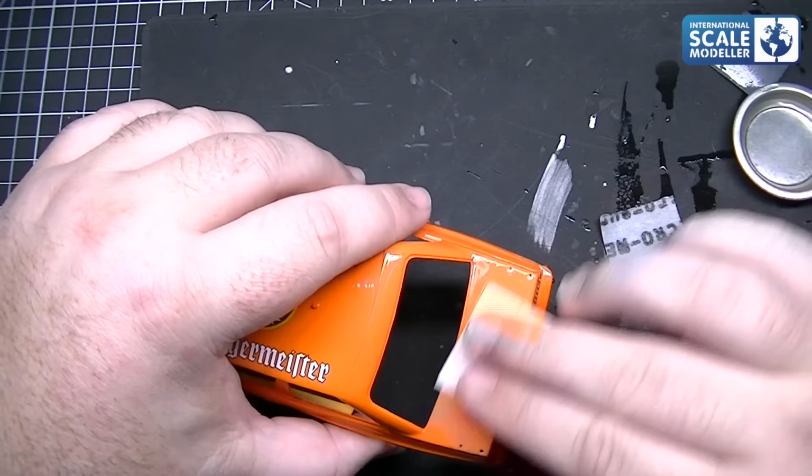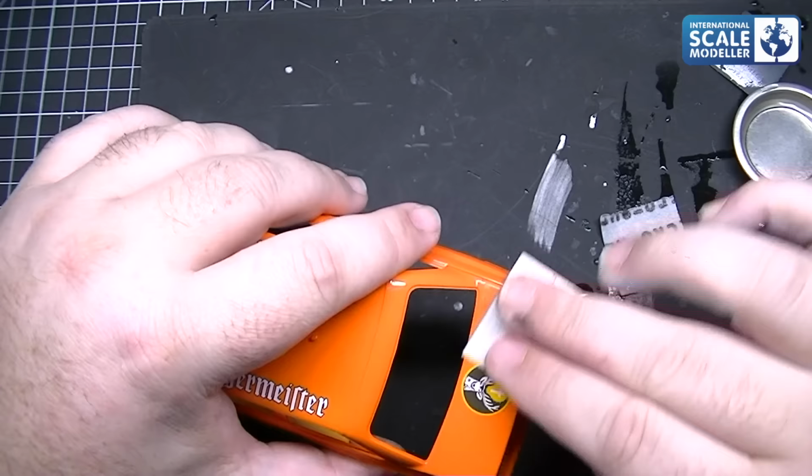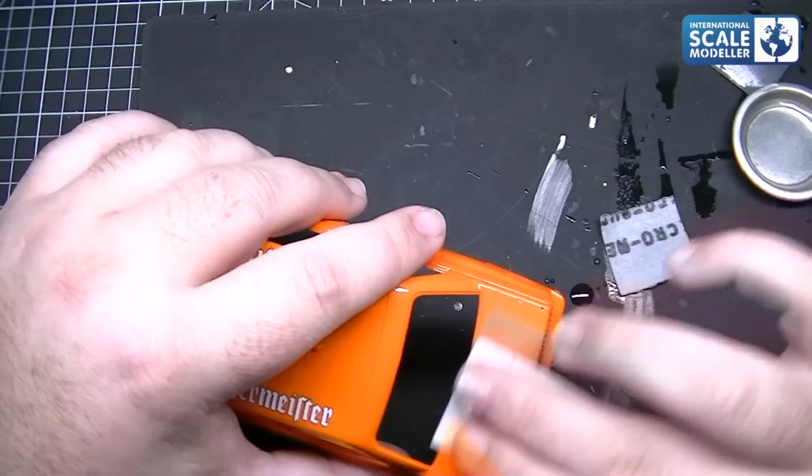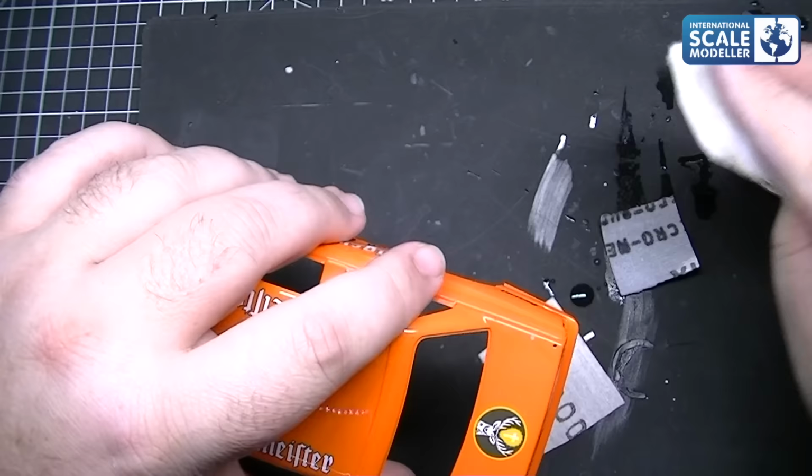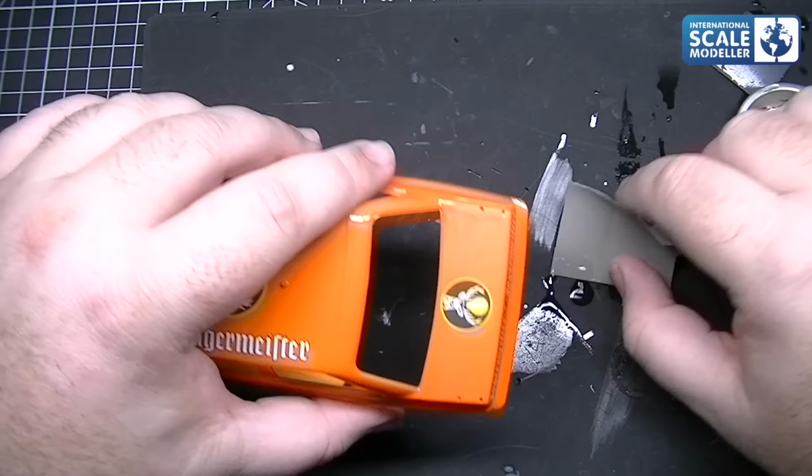So now we're on with our 6,000 micromesh. And what we're doing, we're going to slowly work out all the scratches through the grades until we get to polish. Now, one thing we were discussing when we were doing the Splash 2K was how good it's going to look. Now, what I found is, for doing work like this, it's a little bit too thin. And I found on the side of the car, on the wheel arches, I burned through quite easy just with the micromesh, and that was only 12,000 grit.